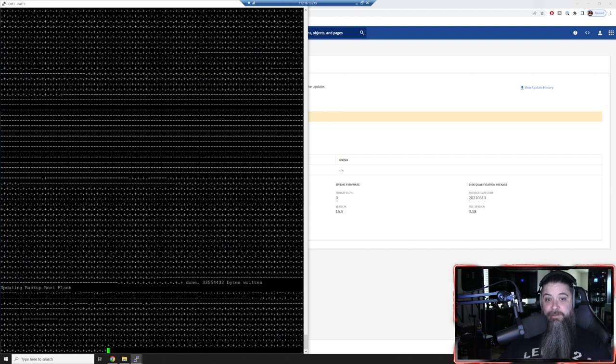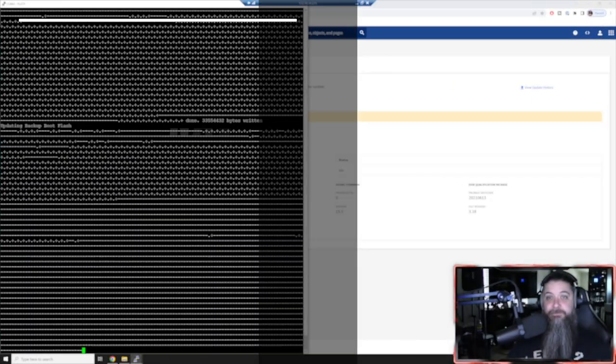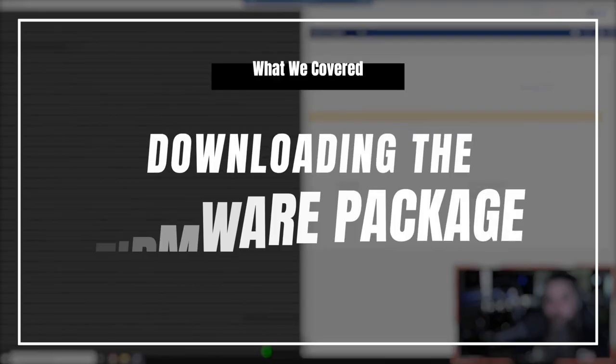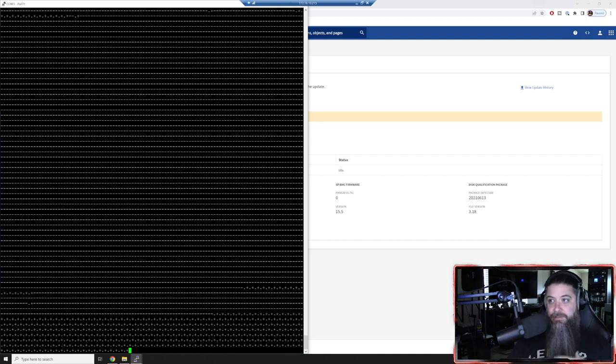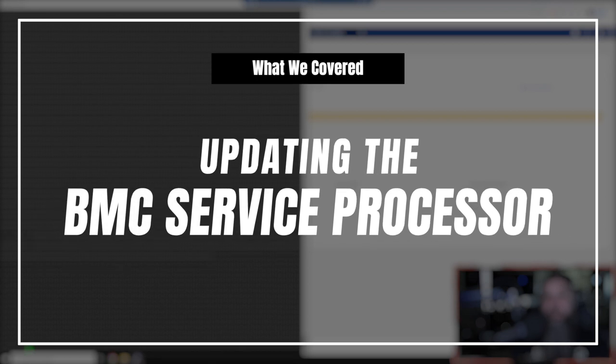So while this is finishing up, let me recap what we did in this video. I showed you how to grab all of the software off of the NetApp support site - make sure you've got your account and auto support set up first. Download your all disk firmware package - grab the all-disk bundle at the top, forget the individual list. Grab your shelf firmware if you have additional disk shelves, because the all disk firmware will update those too automatically - no manual intervention required. You can track it in the logs or in System Manager showing the number of disks remaining and progress percentage.